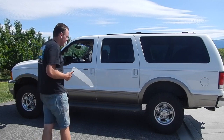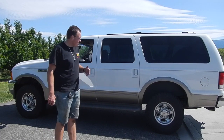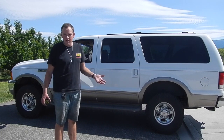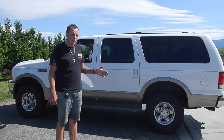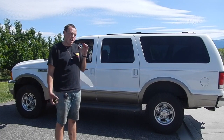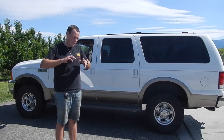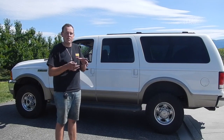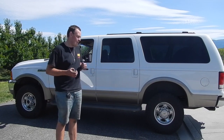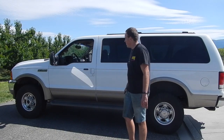I just want to make sure I tell you guys the right thing, so I want to go back to torquing the stuff down. What you want to do is jack up the axles like it would actually have weight on it. From that, you tighten everything down and torque it. If you torque it with it all the way extended, you're going to squish the bushings, and then once they try and twist, they're past their twist limit from sitting. So you want to make sure that you torque them when you're at full weight on the springs. And then the U-bolts you can do no problem while it's in the air.